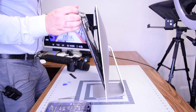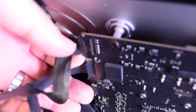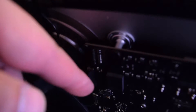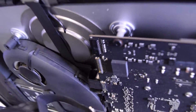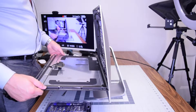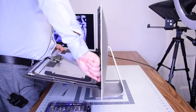Once the separation is started, you can gently pull back on the screen up top and expose the two connections. There's the screen connection and the power for the screen. Pull the power for the screen first by gently wiggling it out of its socket, and then pull on that little tongue to unclip the screen data cable. With those two connections unhooked, lower the screen — it's still attached with foam tape double-sided glue, so use a tool to cut that apart.